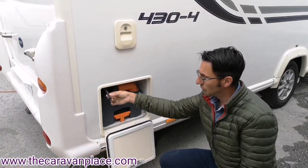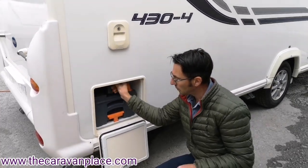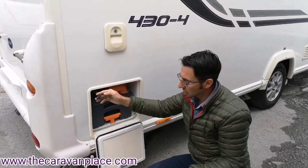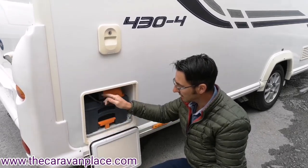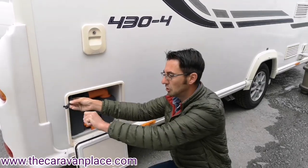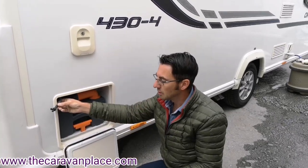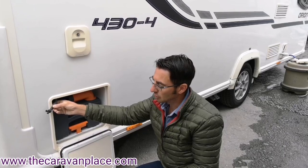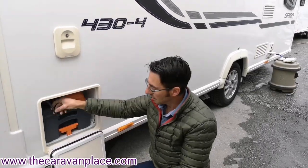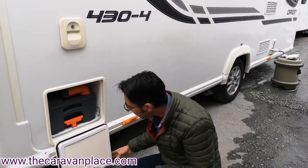To drain the flush water off, there's a little bung tucked up into the top that just pops out — undo the bung and that will drain the water out. Be aware that if you just leave it, it's going to put water into the cassette housing, so you do have to hold it while it drains. Stand back because as soon as you release it, if you've got it pointing at yourself you're going to get soaked. A little margarine tub will catch any dregs at the end. To close it, just push it firmly forwards.